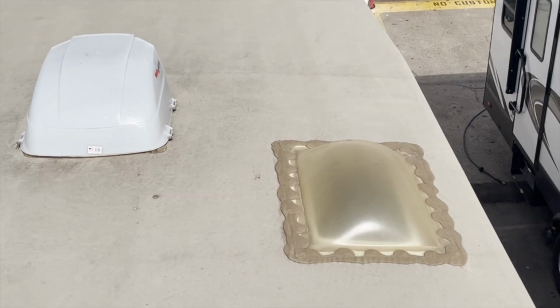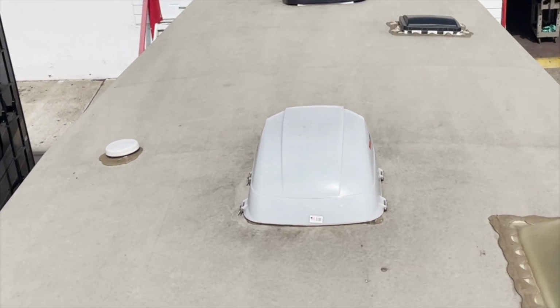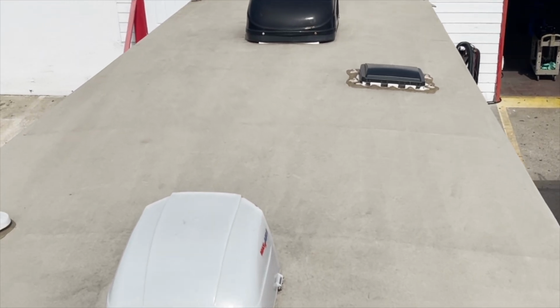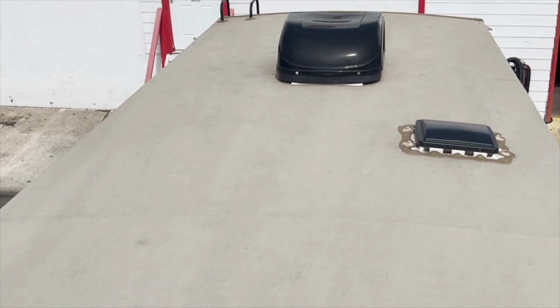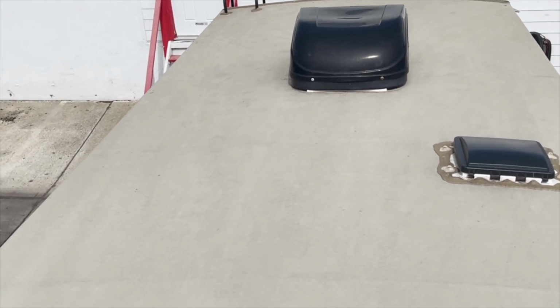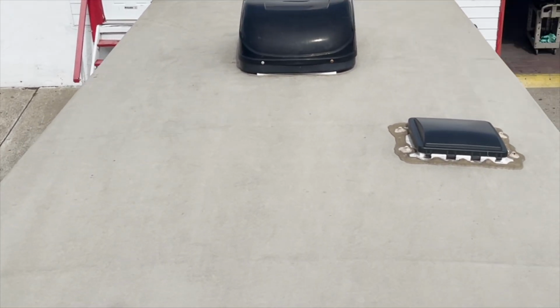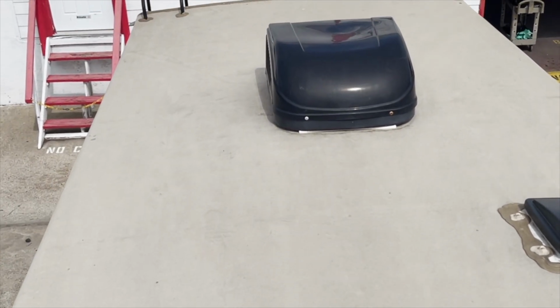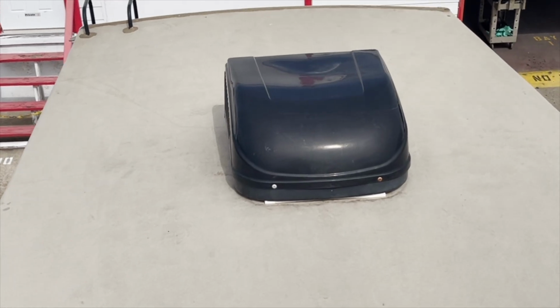So I'd recommend a roof scrub, overlay some of the sealants, thicken some of them up, correct the sealants on the skylight, change all the insert moldings, then doctor up the body wherever it needs. Also, this was built in 2016, so I'm not sure if it's a 16 or 17 model, but every 5 years you want to replace the AC gaskets. And so I'll double check that as well.